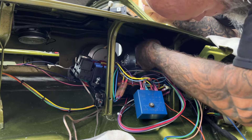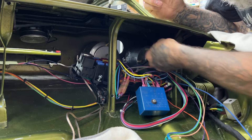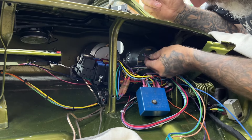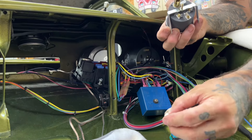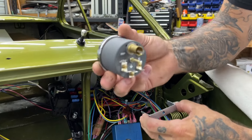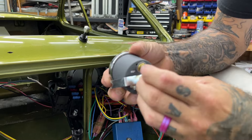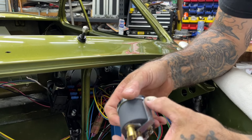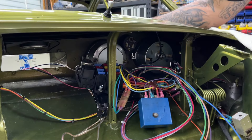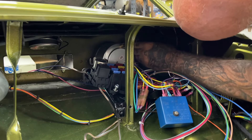There's not a lot of room. Here are our wires, and we'll get all the lights wired in and all these little labeled wires fixed. This is our fuel gauge wiring here as well. What it has is a finger thumb screw and a bracket. This goes in from the other side and sandwiches from the back — it presses up against the dash. These fingers press up against the back side of the dash. This one goes in from the front rather than from the back.